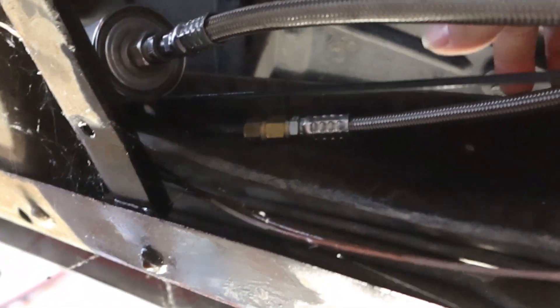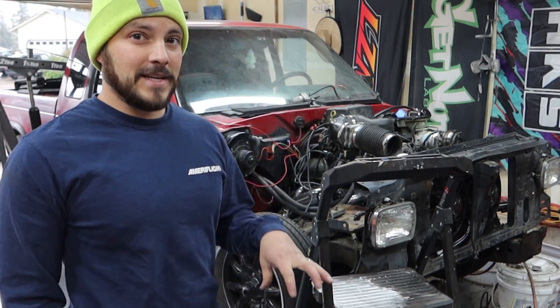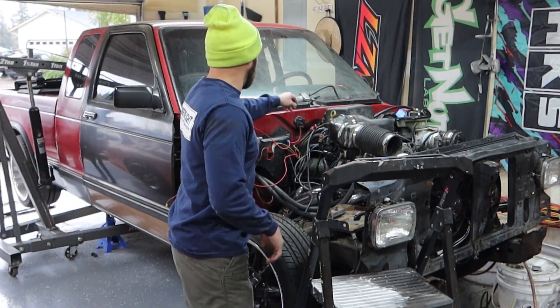That's definitely really good. I got a small fuel leak - you can see it's wet right here. Looks like the return line is the issue. Alright, so I fixed the fuel leak on the return line. I went ahead and hot-wired the fuel pump and it seems to idle longer. I think I need to move the distributor a little bit - I don't know which way is advanced and which is retarded. But we're getting pretty close; I got it to idle for a second.